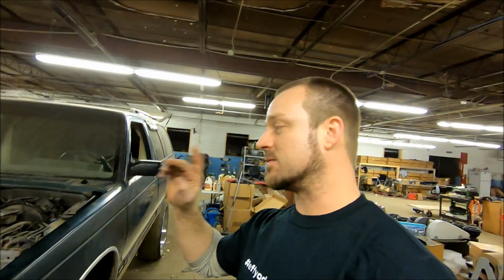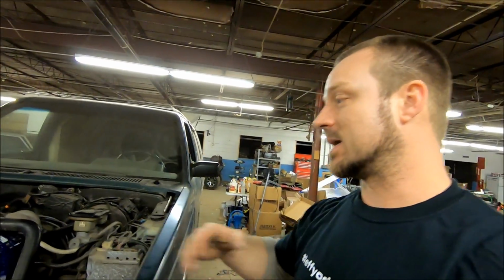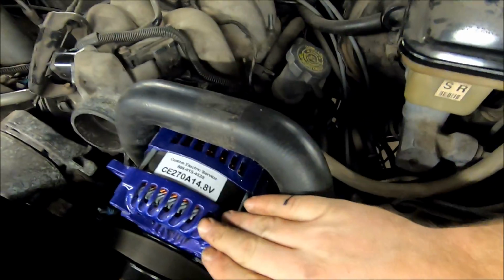One of the other things I told y'all previously I would talk about in this video is how many runs of power wire do you need? So here's what's up. I have one run of positive and one run of negative going throughout this truck, because I'm only running a 270 amp alternator. Even if I was running a 300, 320, one alternator, no matter what, I'm running one run of power wire.